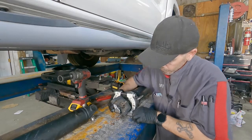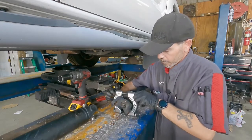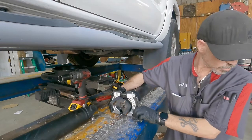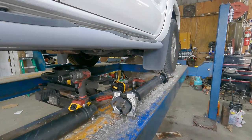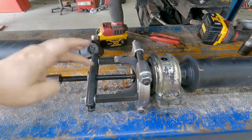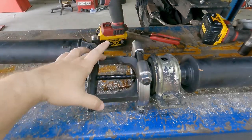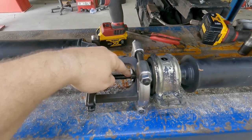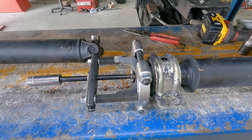Here's a cool thing — we love comments on our feed. If you have something good to add that will benefit the watchers, maybe an alternate way to do something, please feel free to comment. This is the way we do it, but somebody else might have a different way that works better. It's pretty self-explanatory: as you start twisting this rod, it'll start pushing the yoke out, because the yoke is being retained by the retainers. The spacers on an inclined plane help force it out. Notice how everything is aligned — we're in the center, not off to either side, so when you pull it, it will not distort or twist the yoke.